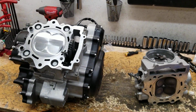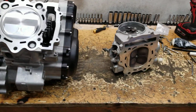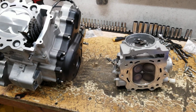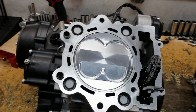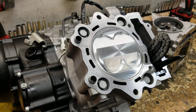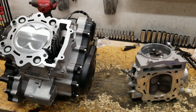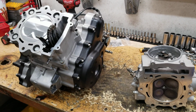So that is what is required to get you to the 90 horse range on a bolt together engine. So whether you're out drag racing only or you're out playing, with this motor size combo, if we change the cam and run standard fuel because you just want to play bike, we can tone it down and make 85 horsepower, which is normally where they sit on 110 fuel. So we do have a high compression piston here with that. We have done in the past pump gas motors in this range. They'll make right about 80 horse. We don't do a whole lot of those. I don't recommend doing those, but certain circumstances require pump gas to be pushed to its limit, and it is possible to do.